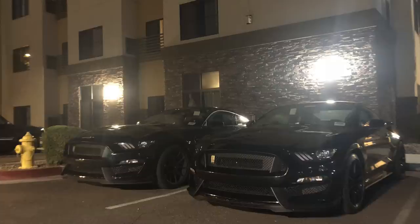You may have noticed I didn't oil the O-rings, and that's for a specific reason. Long story short, I met a Ford engineer around October of last year, and he happened to be testing the Ford GT500 engine inside of a Shelby GT350 shell, which confused me because I thought it was a 2019 GT350 when I saw both of them parked. But this particular engineer worked on the Voodoo engine when it was released, and he recommended that I don't oil the O-rings on the oil filter housing. The reason for that is to avoid the possible loosening of the filter due to the high vibrations of the engine. He did close with, it may or may not happen, but he recommended I don't do it, so he must know something. But anyways, time for the components check.